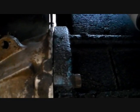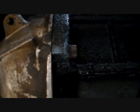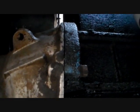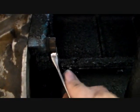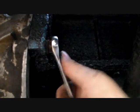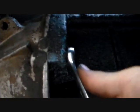Okay, now I'm looking at this and I can see that that crack is just a little bit wider at the top. So I'm going to go ahead and jack back up on this transmission just a smidge till I can watch that start to close up. There we go, and I saw the engine raise just a hair bit too, so that tells me that I can go ahead now and draw this in. And I'm not going to tighten it up, you know, torque it down, but there it is, man.